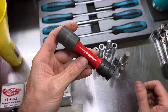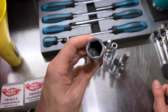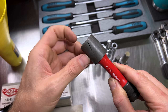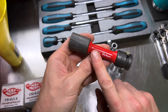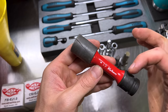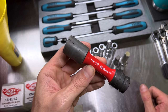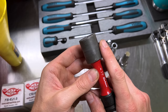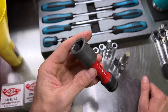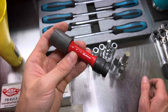Next is the Koken 14145PM — a 19-millimeter lug socket. This is great if you work on a lot of Subarus. It does not have torque limiting; it's not a torque stick even though it has a necked-down section — that's just how they're color-coordinated by size, not torque setting. So don't run these with an impact and think you've torqued them properly. They're super thin-wall with a protector sleeve to avoid scratching inside wheels, plus a plastic cap to protect the Subaru chrome lug caps. More useful for dealership work than a one-time DIYer.